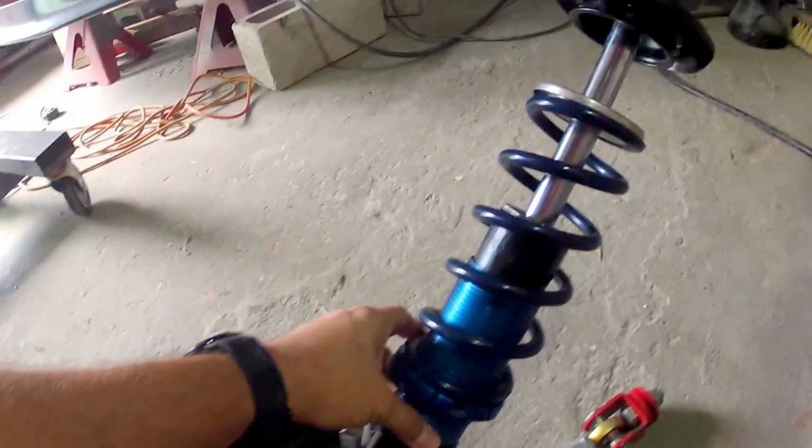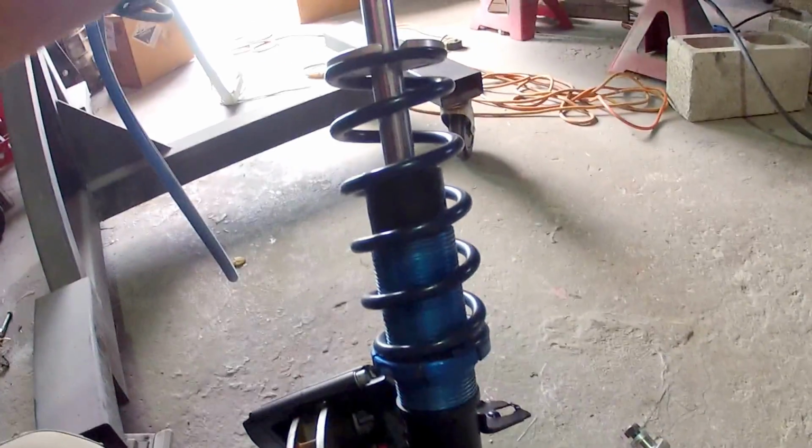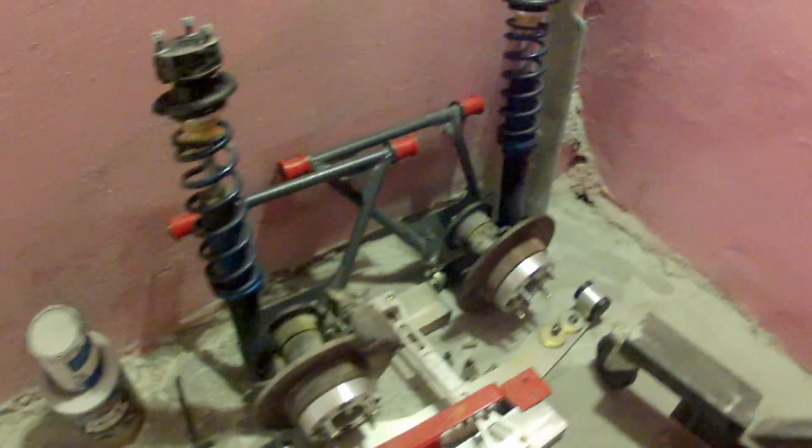Also, a fully customized coilover setup, I'm not sure where we got that from, but we sectioned the struts to allow for the adjustable, shorter Tokiko inserts, fully adjustable. So they will be installed. Well, most of these things were installed, or at least test fitted, and came off the car to be worked on. These are the rears here without the brakes.